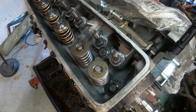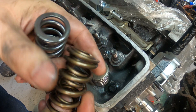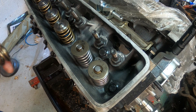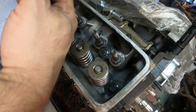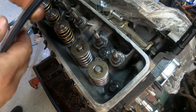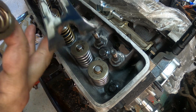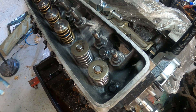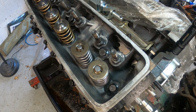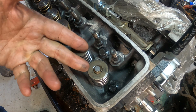The reason why this kit comes with a couple of extra parts — these are the single valve springs we used, and these are the double valve springs. The valve spring compressor works for the single valve springs, but for the double valve springs it's kind of wonky. My other valve spring compressor did finally come in, but I'm not happy with it either. It's what I have to work with.